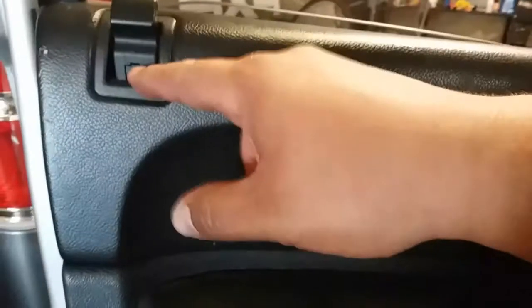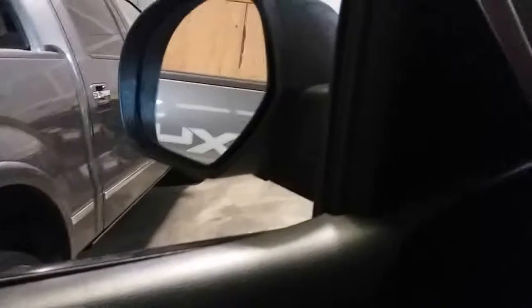There are a couple of plastic trims that you have to remove. This one's already removed, but you just pop that one off. There's another one here, and there's another one right here. We might have to pull this one out as well to get this door to come off. So let's go ahead and use our trim pry tool — there it is, that one comes off.